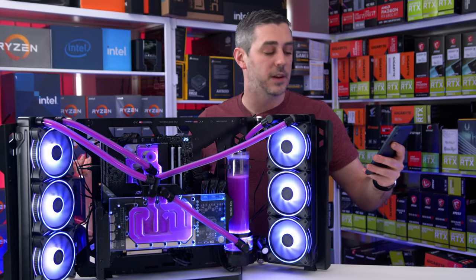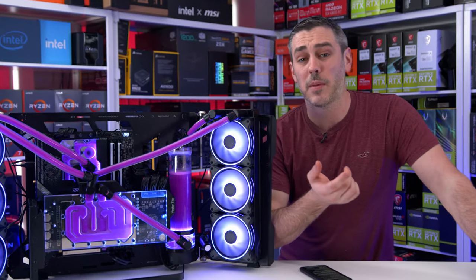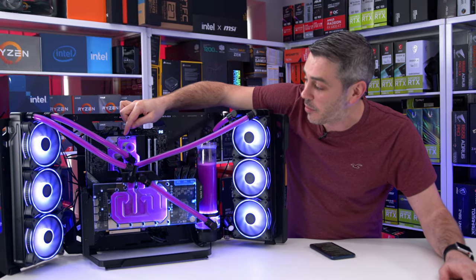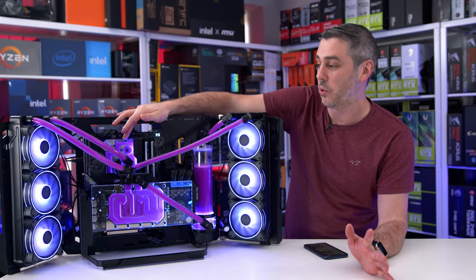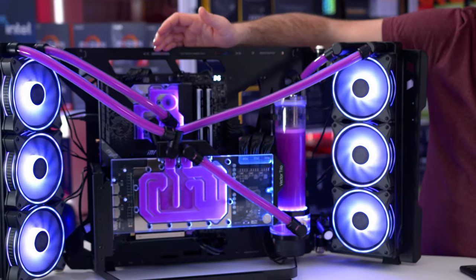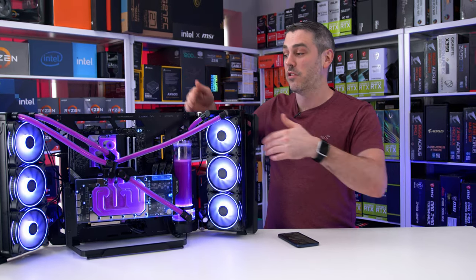Next comment: 'What's with the air bubble in the CPU block?' This thing weighs an absolute ton, so trying to get air bubbles out is just asking for trouble. It actually takes two of us to lift it and try and get all the air bubbles out. When we first turned this on there was no air bubble at all — we shook it about and got the air out, but since the beginning of filming this video an air pocket has arisen again. The reason is gravity — this is basically one of the highest points of the loop. The other high points are the two rads on either side, but other than those, this is the highest point, so air will naturally try and get up there. Over time this will subside. You can see our built-in flow meter on the monoblock — it's not actually causing any problems whatsoever. Things get missed in videos, but it's still functional and works absolutely fine.